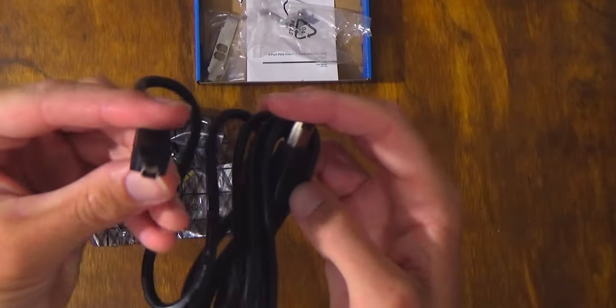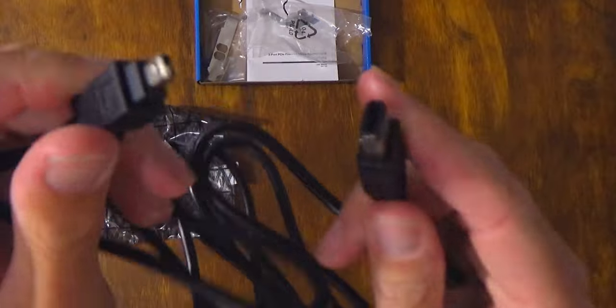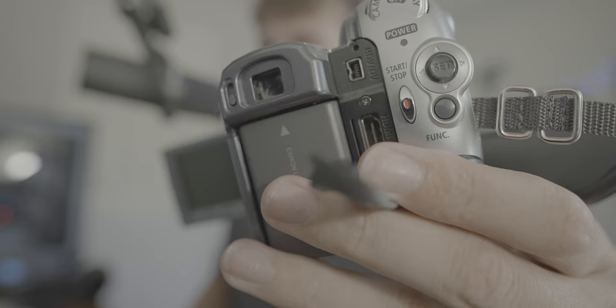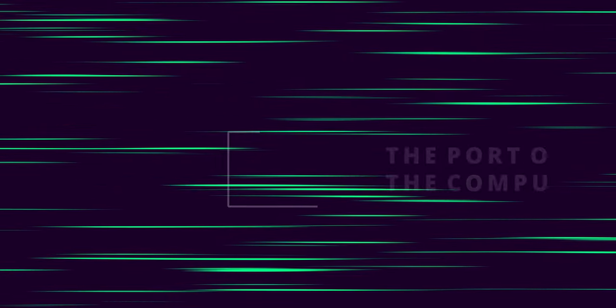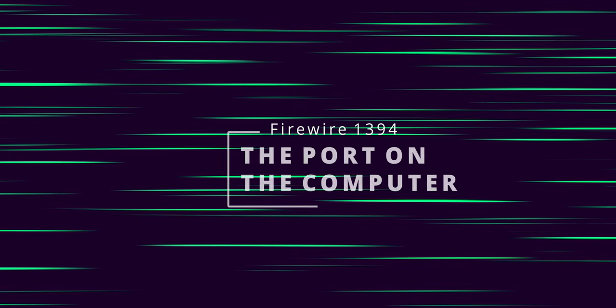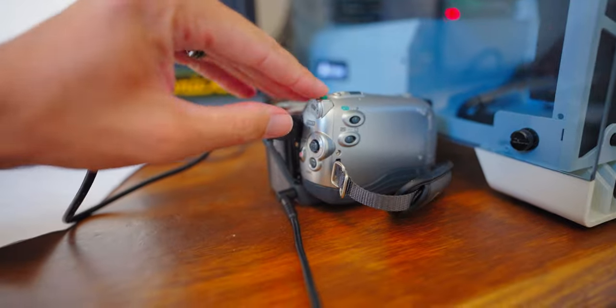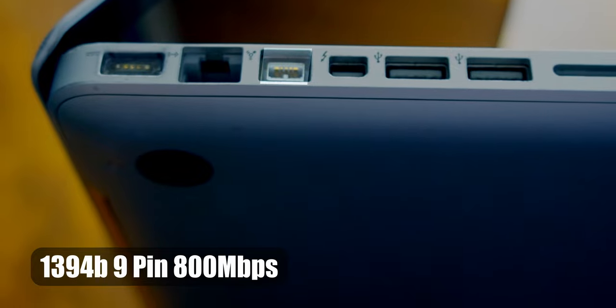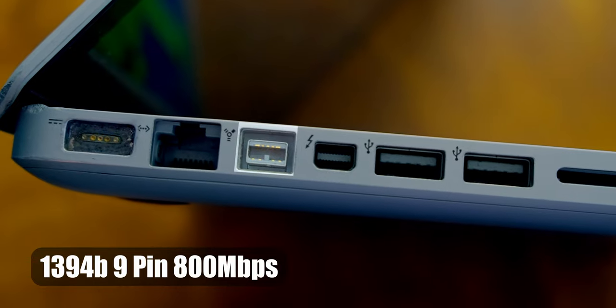Firewire has a better protocol than USB, but all you need to care about is the name of the cable you need to buy. You're looking for a Firewire 400 1394 4-pin to 6-pin cable. Your camcorder needs to have a 4-pin Firewire port; the cable needs to have 4-pin on one end and 6-pin on the other end. In order to plug this cable into your computer, you will need a Firewire 400 6-pin port. Maybe you have a Mac from the early 2000s that has a Firewire 800 9-pin or a 400 6-pin port — in that case, this is likely your easiest and cheapest option. Check your older hardware to see if you've already got Firewire.